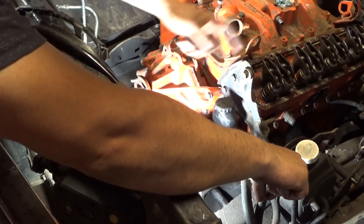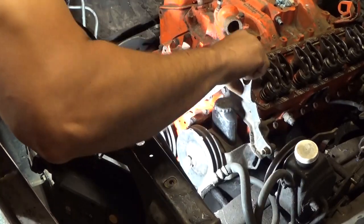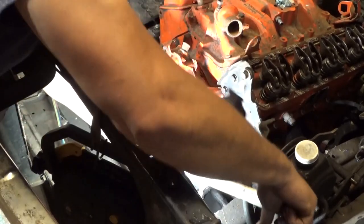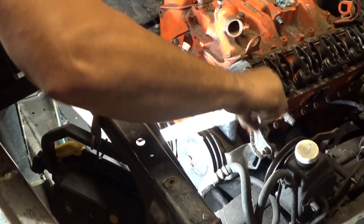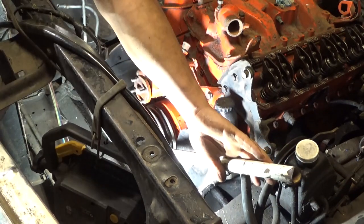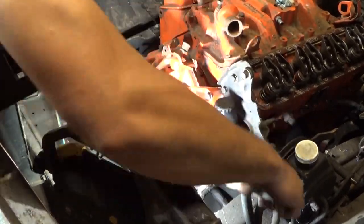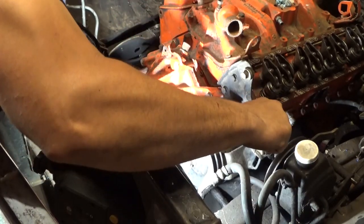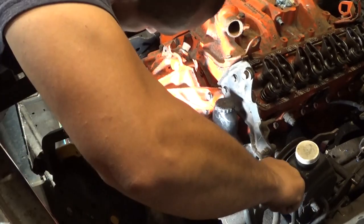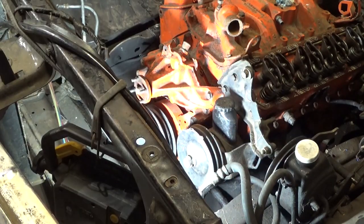When it hits the bottom it's going to close, and on the way up that's going to get into your compression stroke. See the intake valve opening — now it's closed. And the timing mark is 180 degrees away. On the way up it closes both of them. And boom, that right there is where we're supposed to fire on number one.